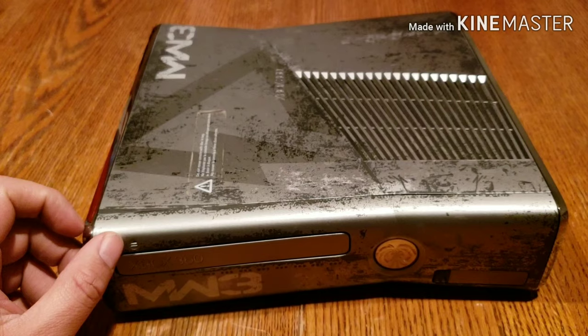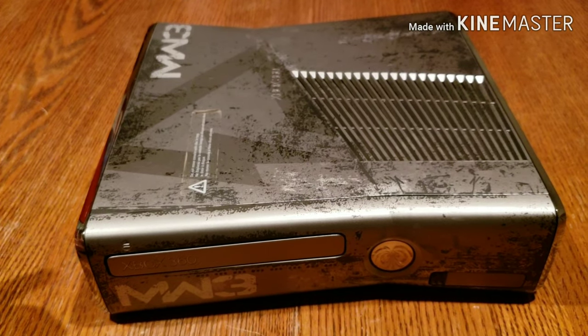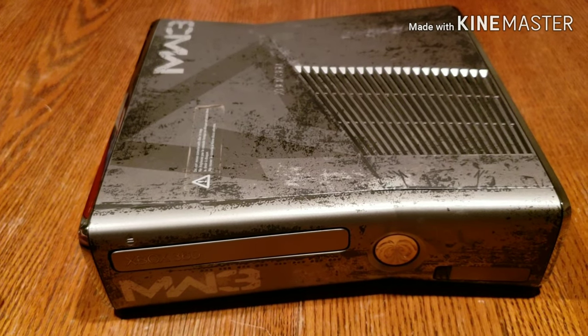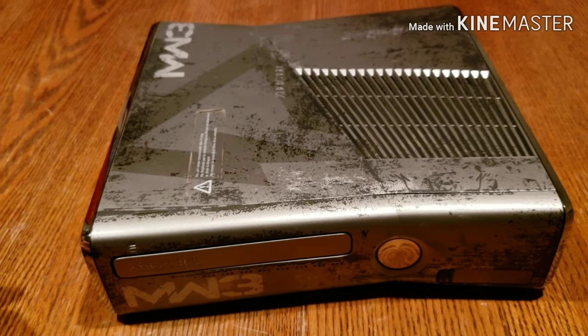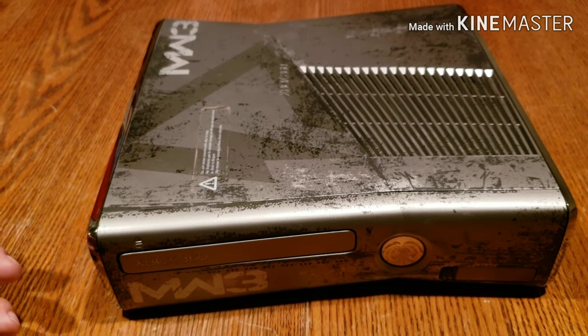And, you know, I did kind of a half-assed job. Instead of actually replacing the thermal paste, I put it back together. I'm like, it should still work. It was dry and it had a little bit of thermal paste left. I went to go try it out. It booted up fine, but then it started having overheating problems.